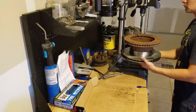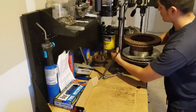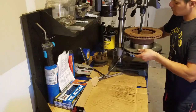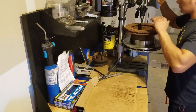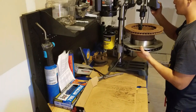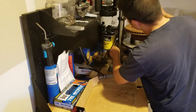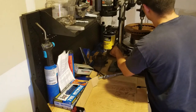Here I placed that Cherokee rotor over the Grand Cherokee rotor using that center mark so that I can get that new hole centered right on that mark that I made on that Grand Cherokee rotor. I'm using the drill bit to keep centering it, and we make the final adjustments onto the drill press and stabilize our pieces.